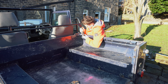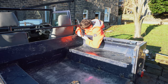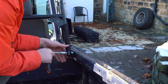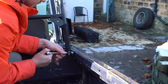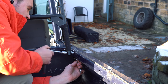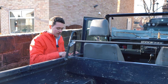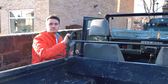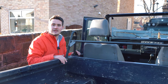The first part of the install was easy — just putting a bolt through the arm of the bar through to an existing hole in the body. This gave me a good reference point for where I'd need to drill the rest of the holes in the tops of the cappings. I did these up loosely to start with because there'd be wiggle room. I also need to run the seatbelts through and mount them into the bracket, then we're basically done — a really quick and easy install.